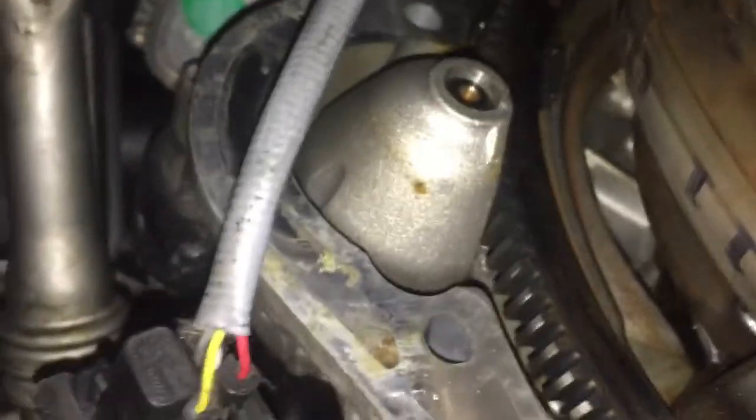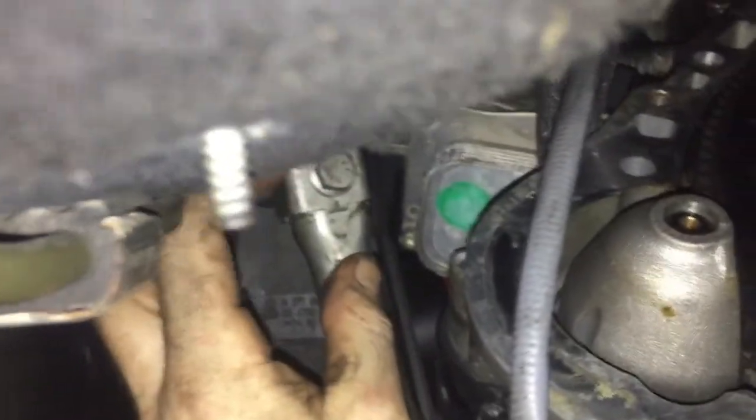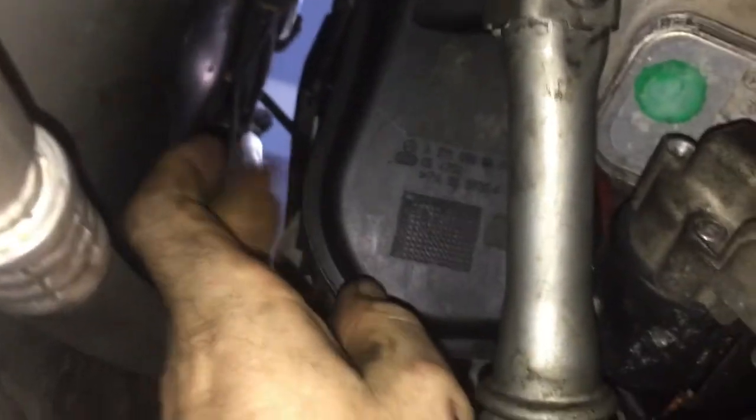So they're also 14s. So if you want to change your starter here, you have to take this piece out because it's in the way. You have to undo the steering bolt here, pull the stem down. You have to take this piece of the box out that goes to your supercharger, and then you can finally move the starter out. But since we're only changing the transmission, all I had to do was knock it back, you know? And then whatever will happen, I'll put it together and then I'll just put this back in and readjust it,